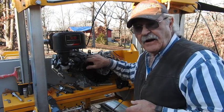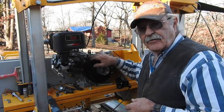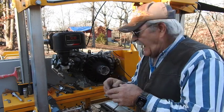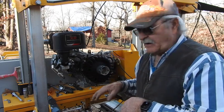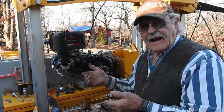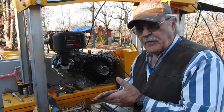These are fitted with essentially a magnetron like you'd have on a riding mower or anything like that. The way the magnetron works is there's a permanent magnet on the flywheel, and whenever it passes through this coil right here — those pickup points on that coil at a specific distance away — it'll generate a spark, and that's what gives you the spark to your spark plug. To shut it off, you actually have a series of grounds; when you turn the key off, you're not disconnecting power, you're actually grounding out that magnetron so it kills the spark.